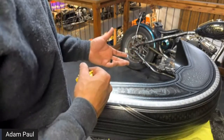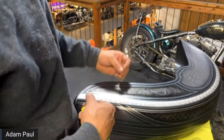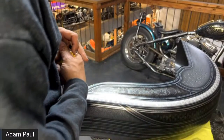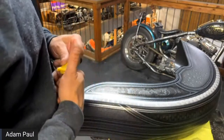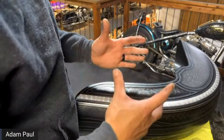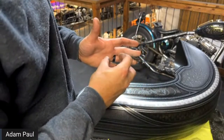If you were to spray the primer and you were planning on doing a wet on wet and somebody called and you ended up talking on the phone for an hour and you came back and sprayed your base coat, there's a good chance your base coat's not going to stick anymore because it doesn't have that chemical bind anymore, because the primer has set up too much. So you have a window there, and it's easier because you don't have to wait for it to dry and you don't have to sand it. But also, remember, when you sand primer, you're also getting rid of defects and smoothing it out and doing other things like that. So that's why I prefer to let it dry and then sand it and then let that next base coat attach to the scratch. Because like I said, you either have the chemical adhesion with wet on wet, or you have the base coat attaching to a scratch or a grit rather than that chemical adhesion.